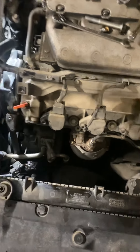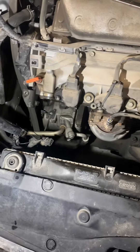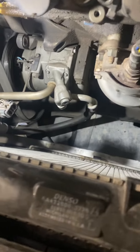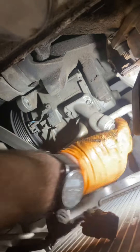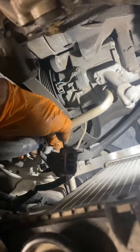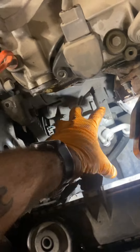While I'm in here I might as well cover the AC compressor as well. The way I did it: I pulled the alternator first, then reclaimed the AC refrigerant. While you're down here, remove the 10 millimeter bolt here, and there are two little guys you've got to remove for the high pressure line and low pressure line, plus one electrical plug here — those look like they're 12 millimeters — so one, two, three, four, and at that point the compressor will come out.